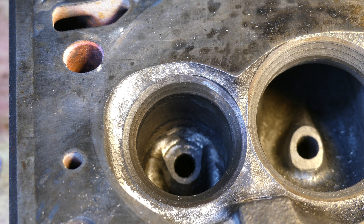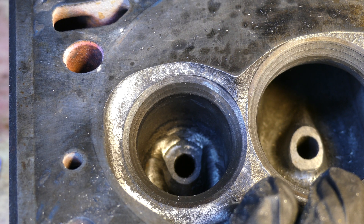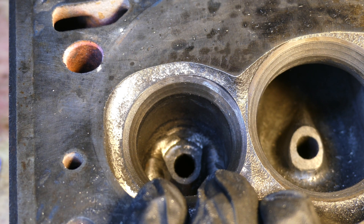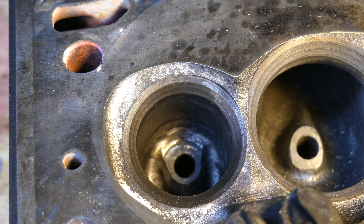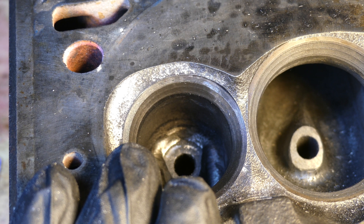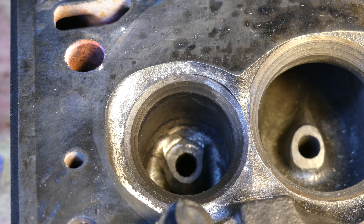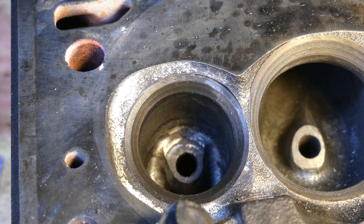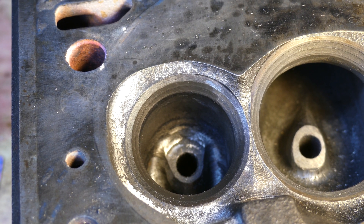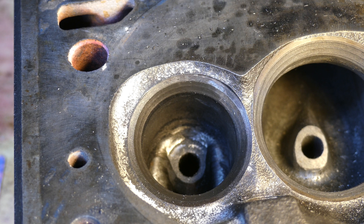This is something you can do to your head on your own time. The exhaust port is going to take you about 10 to 15 minutes each, and the intake port is going to take a little bit longer — but this is the part that actually takes the most time. The chambers are going to take a good 15 minutes each as well. This is not something you're going to do in just two hours. It should be done with time — maybe put two hours a day into it during the week. One day finish all the exhaust ports rough cutting, then rough cut the intakes, and go from there. Try not to rush this process. Take your time, let the carbide do its job, and when you're done you'll have really good results.